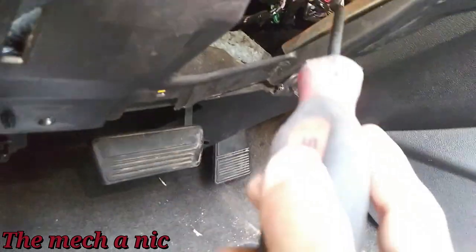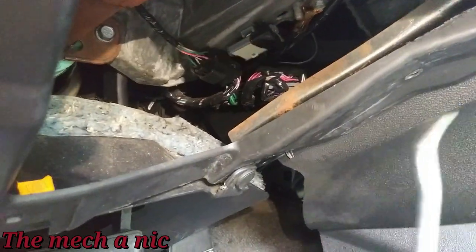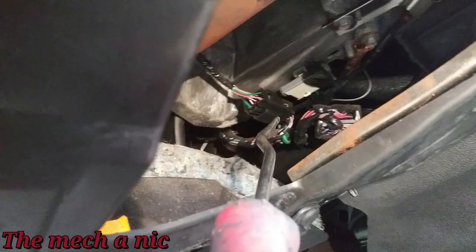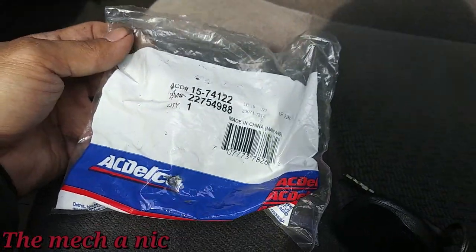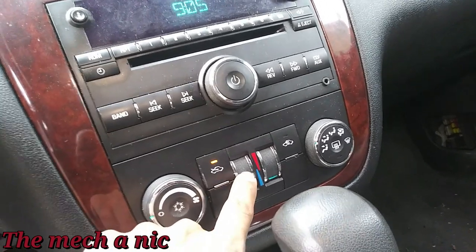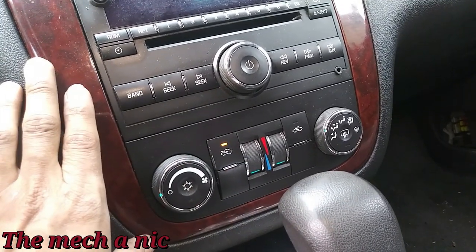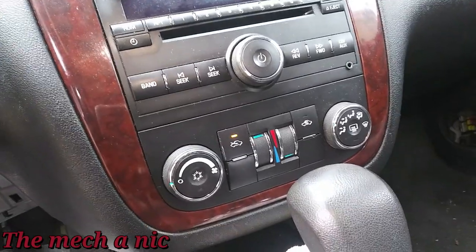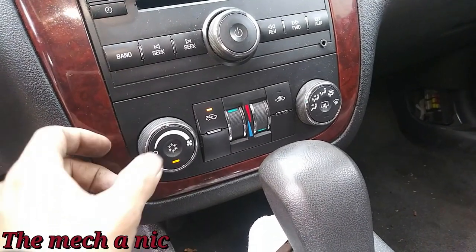Next thing is this blender actuator — or hot/cold actuator, I'm not sure which one it's called — it's back there. It's a bit of a pain to get to so I'm not going to be able to record getting it out. Actually it wasn't that bad to get off. Here's the old one, and we have a new AC Delco part. New part is installed and it's nice and quiet. This is the one that moves the blend for heat and cold — you can see we can move it back and forth now and it's not making a noise anymore.